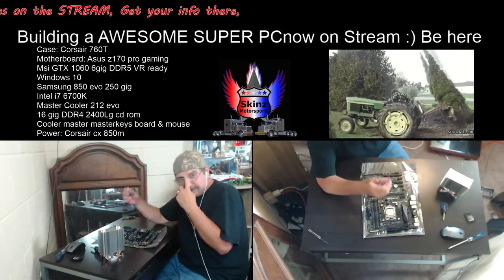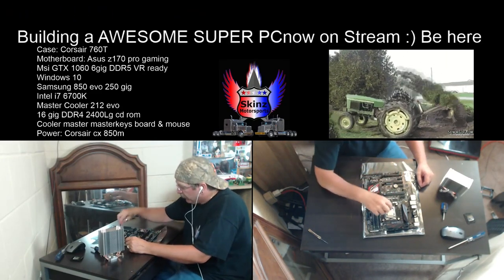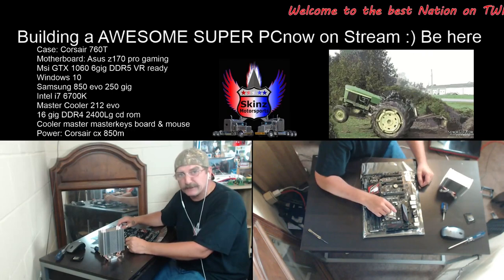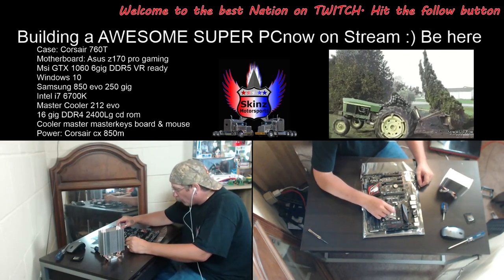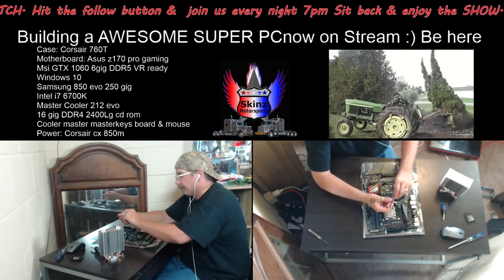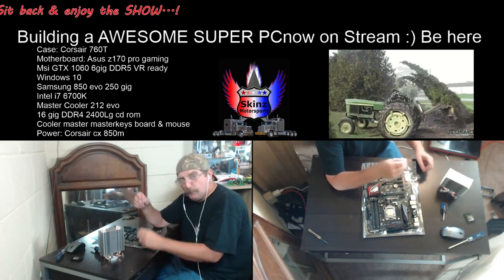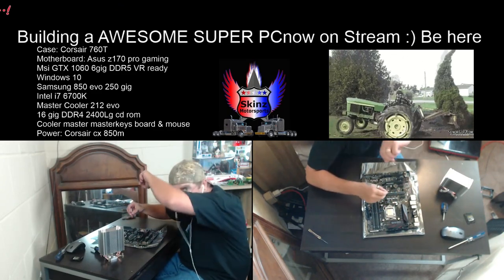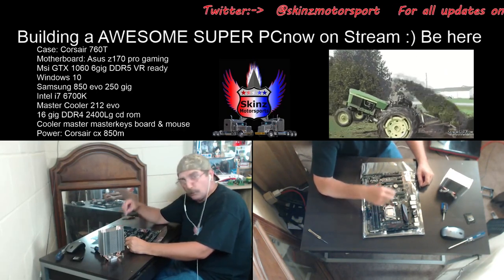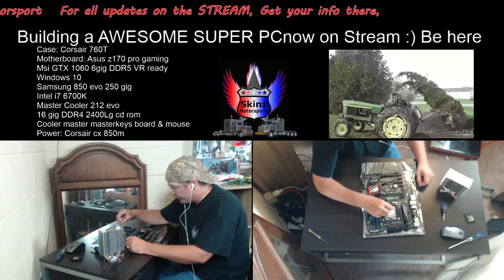Alright. This is the part where we're going to put thermal paste on. On the upper camera, on here, we want to make about the size of a pencil eraser dot, right in the middle of the processor chip. This is kind of a stringy paste, so when we go to dab on there, we're going to make sure that we pull straight up, down, swirl it over the top of our dab.